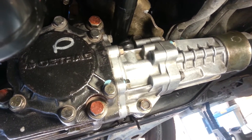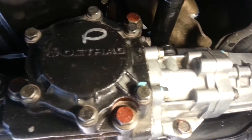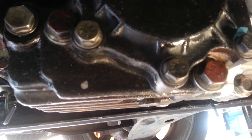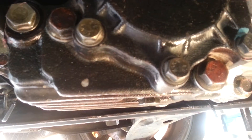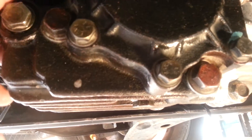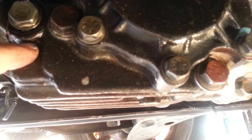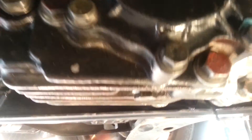They do the job. These are the main five bolts — the ones with the red caps on them — and then the two shorter ones up in the back. I filled the transfer case while it was on the ground. It's got a flat bottom, so as long as it's level. I measured out 270 milliliters and poured it in, making sure that it was a half inch low below the cap. That's the fill, and that's the drain right there.